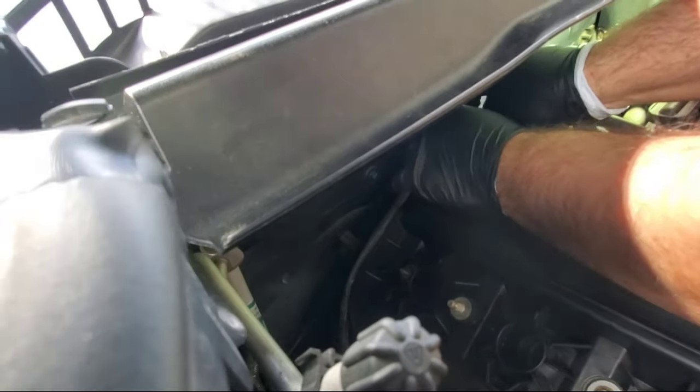Make sure you check the back and remove every piece of gasket still on the head. Stuff microfiber cloths down in there to prevent debris from falling into the engine while you pry off the old gasket. It will chip off because it's so hardened. I'm now in the cleaning process — take a microfiber cloth and dust away from the engine. I've cleaned this portion and you can see it's already better.